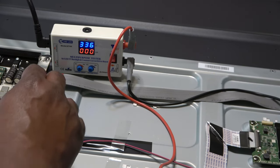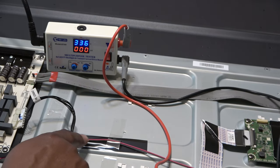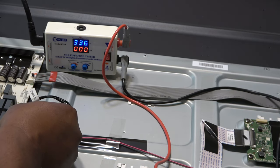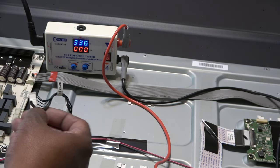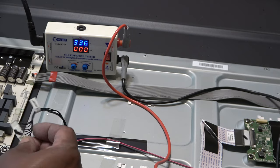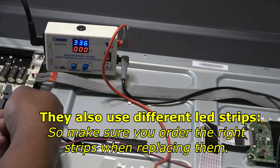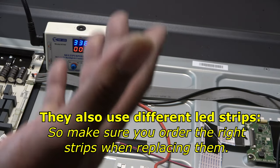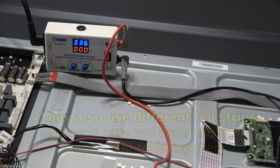Okay, this is our LED wire, LED plug, which goes, as you can see, inside of the TV. The 75R6E3 has just two lines. This one actually has four lines. And even though it's marked positive, negative on the legend, when we test it, our negative lead goes here, positive here. Negative lead here, positive here. That's two lines. Negative lead here, positive, and so on and so forth.